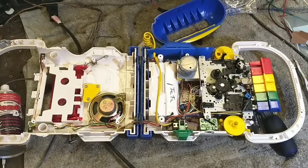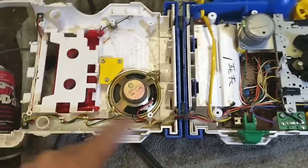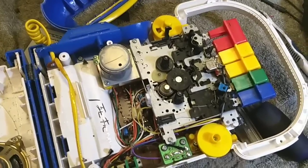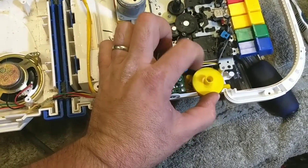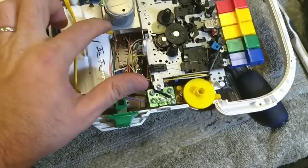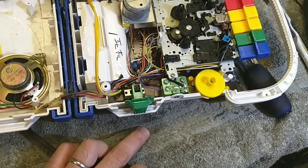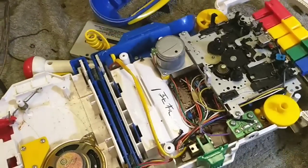Obviously, there's your speaker and your cassette door. You're going to want the cassette door open when you try to separate the halves. Here is your standard transport — this was very common to Sony boom boxes, late 80s, early 90s. This one's got a date code of 93, so that about works with that. The points of interest: we're obviously going to have to take the transport up, which is just these three screws here — one, two, three. This comes up and then we can get to our belts and things. While it's up, we can address cleaning the switches and controls, which are very touchy on this machine. Then we can go about seeing if it actually runs correctly.